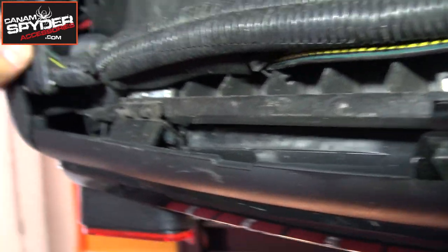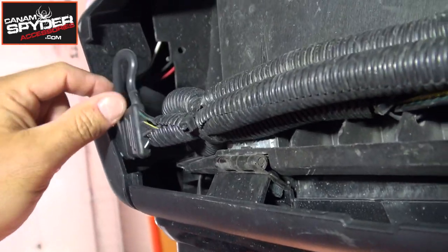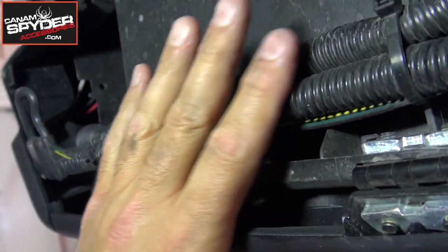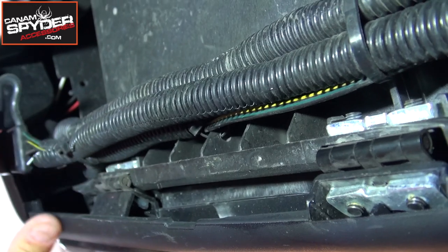I leave my four pin flat right here, and all the excess wiring is there, and some of it is underneath the seat. So that was easy enough — it's about a 20 minute project, the only thing you have to remove is the passenger seat. Invest a little bit of time to make everything nice and aesthetic, making sure that wiring is secure to the bottom of that saddle bag. Split it half and half — put some underneath the saddle bag and the rest underneath your seat.